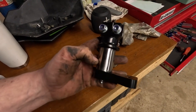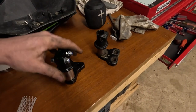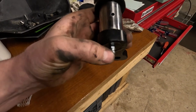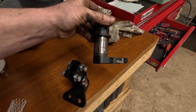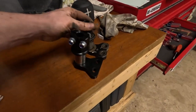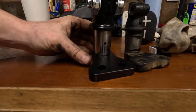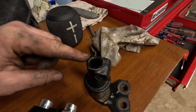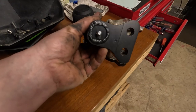Here's the J-Parts pitman arm. Like their steering stem, they put a stainless steel sleeve right here so it doesn't wear - unlike this old one here, you can see that it's worn. The other thing I like about this J-Parts is they put a grease zert fitting on the bottom so the bushing will actually get some grease, whereas the other one doesn't get any grease at all. It's pretty heavy duty, about the same thickness. One other thing is this one has a single bolt that clamps on the power steering unit, while this one has double bolts - it'll hold on a lot better.